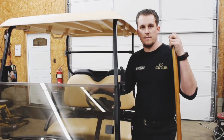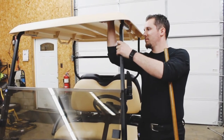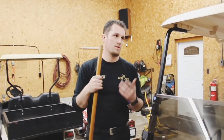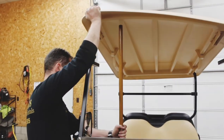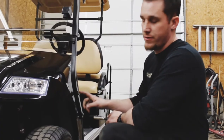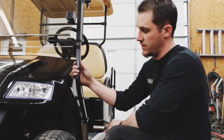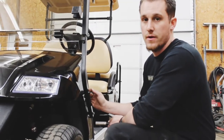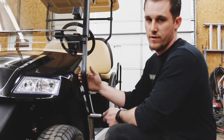Take the roof assembly and separate it from the struts. Make sure you have something sturdy to support the roof — tall enough to hold it in place when you take the struts out. There are two 13mm bolts holding up the roof strut assembly. Remove both of these bolts, and make sure you hold on to the hardware in the rear as it is not supported. At that point you'll be able to remove the strut from the body.